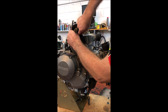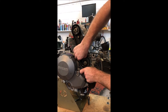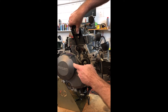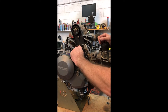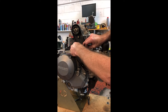This belt is hard to get off because the camshaft is near the nose of the inlet so it has load on it and stays there. If you're not paying attention and you pull the belts off and you decide to put it in gear and turn the engine over with the back wheel, you drive the piston into the valve that's being held open by the cam and you bend the valve. I know because I've done it — it's a really good way to wake yourself up and it costs a lot of money when it's a customer's bike. These fixed idler bearings fail quite early in their life; I've seen 24,000 kilometre old ones seized and cocked. That one is rough and dry so I'll definitely replace that.